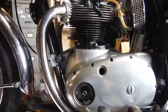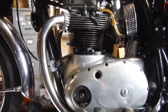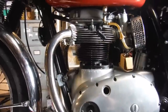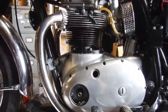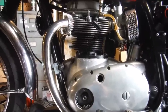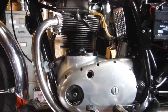I'm going to carry on and get the sump plate off and check for any unpleasantness there. If that's clear, I will ride the bike again — certainly up and down the lane if no further — and see what it feels like and sounds like, because sometimes these simple things can make a hell of a difference. There could be a degree of wear in the engine; I don't know the history of it. I'm going to have to mull this over and discuss it with the owner, and then make an assessment as to what happens next.